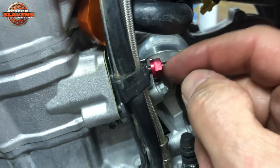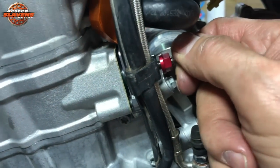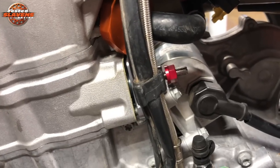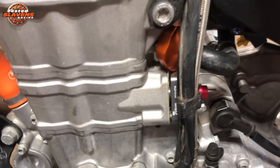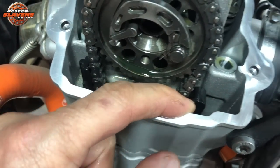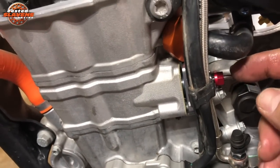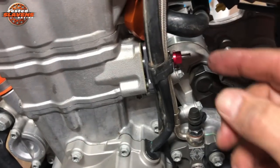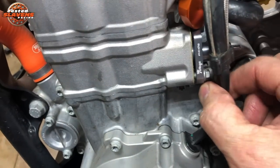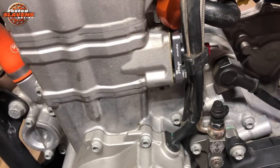Then back off the lock nut and screw the adjusting bolt in until it touches. I just did it with my bare hands, but there is a slot in here for a screwdriver. You just screw it in until it's hitting the cam chain tensioner pad — this piece up here, it's a big long piece that goes down through here and pivots back and forth, and the adjuster pushes on that. So screw it in until you've got good tension on that pad — not hard, just finger tight. Then go ahead and tighten these bolts down. This was a two millimeter gap, and now when you tighten these bolts down you will have a two millimeter preload on the tensioner, which is what Tokyo Mods requires in their setup.